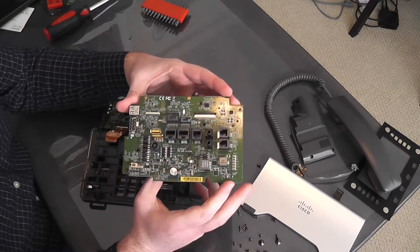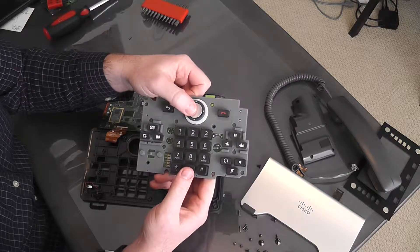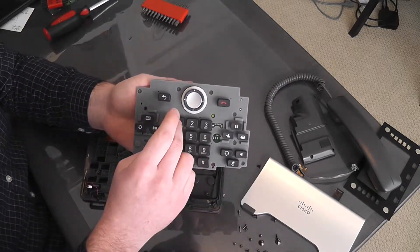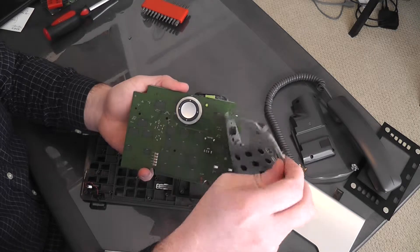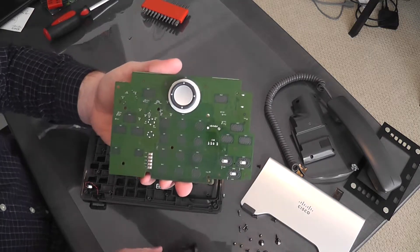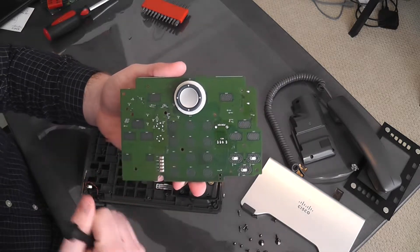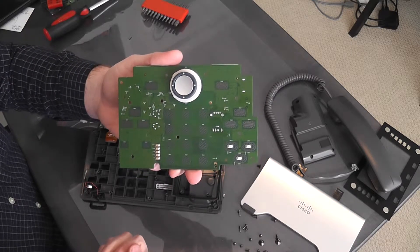This is the back of the phone's main circuit board. The front has the buttons — the controls, the keys, and so forth. These are kind of like a rubber piece that lays over — this is how you keep dirt from getting in the phone. When you take it off, you can see the pads here — when the buttons are pressed, connectivity goes from the back of the button across these different pads and actually causes the circuit to be completed and the keystrokes are registered.